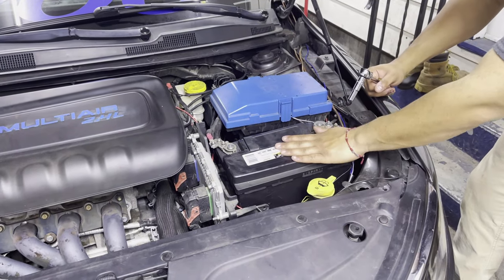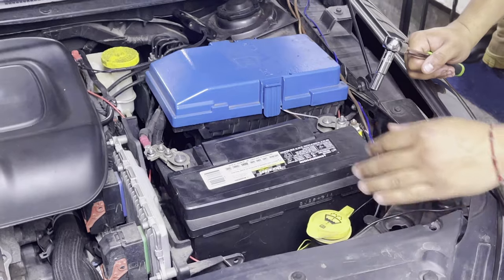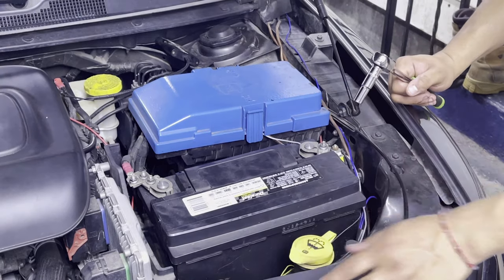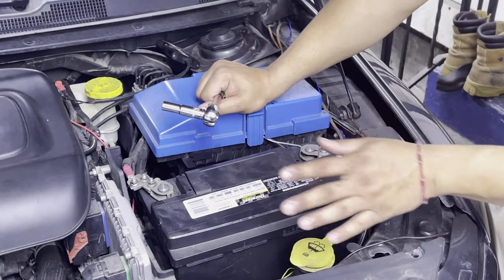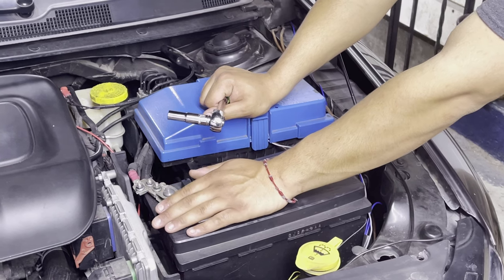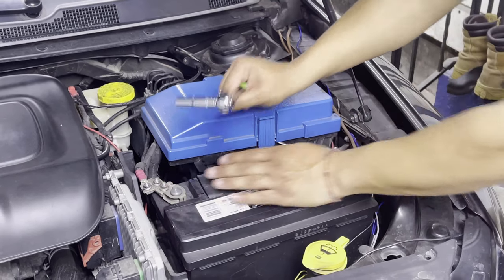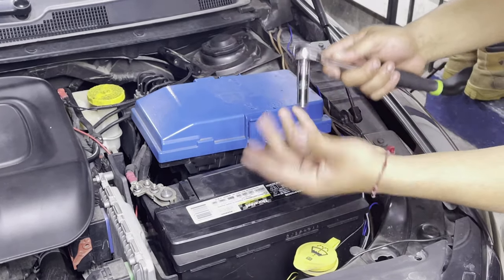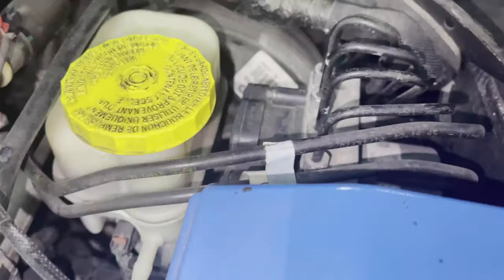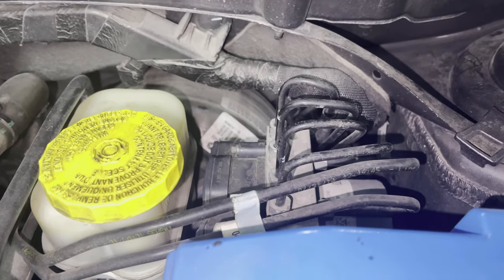First step: when you're doing anything electrical, go ahead and disconnect the battery. I'm going to disconnect my ground because it's easier and I can tuck it away. For your safety, don't connect the red wire to the battery until you're completely done with everything — just to watch out for residual electricity or sparking on grounds that are already there. Take your 10 millimeter socket, wrench, or drill, disconnect your ground, and push it off to the side.